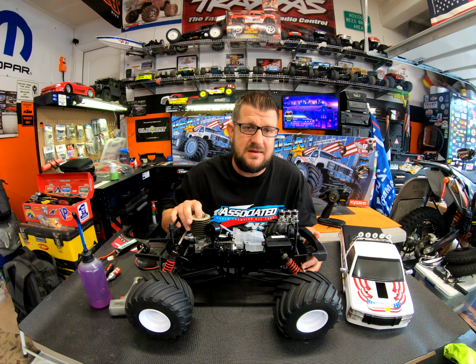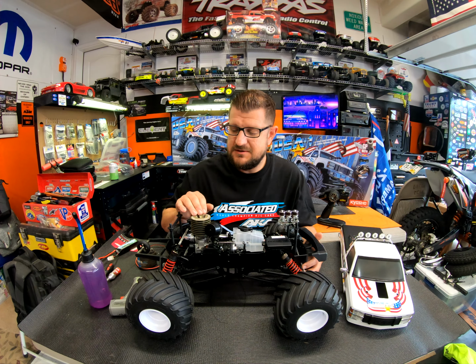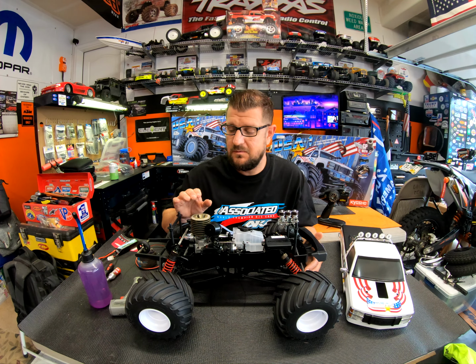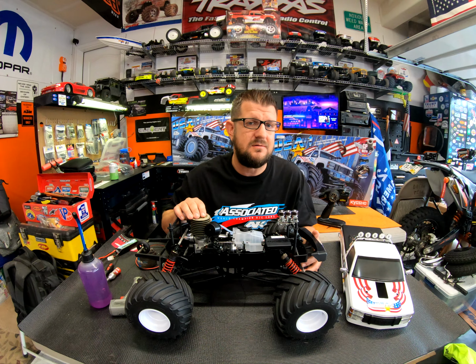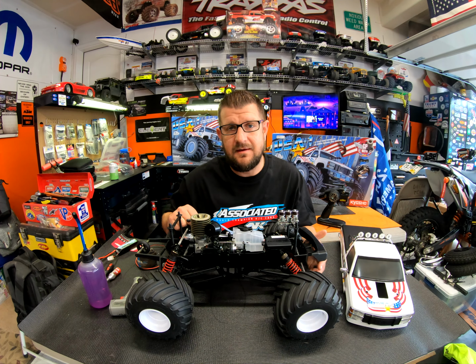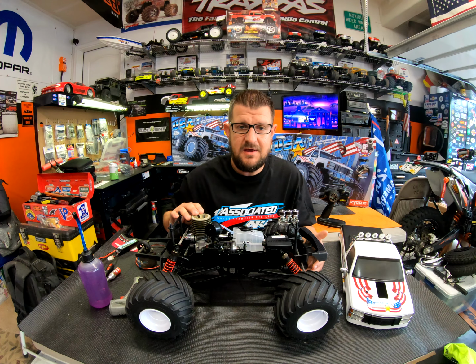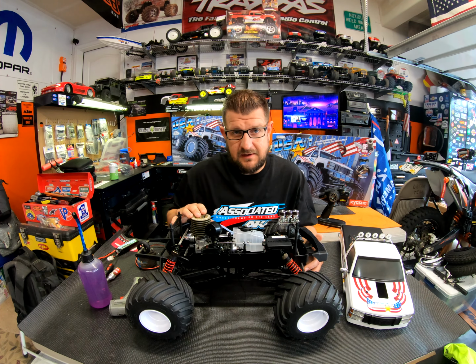It's not really meant for those 8%, 7% lean oil mixtures that we run in the race fuel with 30% nitro. A ready to run engine like this, I would really keep it right around 20-25% nitro with, like I said, north of at least 10% oil content. But for the life of this engine, most likely I'm going to stick with the 20% nitro and the 14% oil content. I think that's going to really produce some long life out of this engine, and it's going to run great. So that's the process I use. Heat cycles